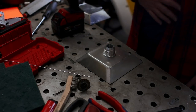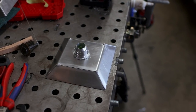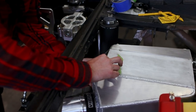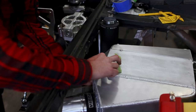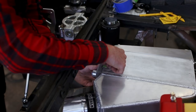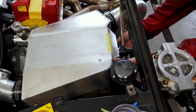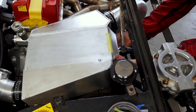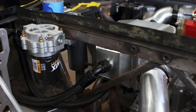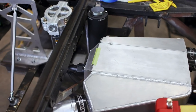This is a pretty good indicator of what we're aiming to make. It'll need a lot of finish welding, but it will do the trick and guide water flow through the intercooler core. The dimensions clear the rear bracing of the chassis and clear the blow-off valve in front of the intercooler, so everything fits. I'm just taping it into place for now to get an idea of how it'll look and confirm the hoses fit. Overall it looks pretty good — with a little modification to clear some welds once we affix it permanently, this is going to do the trick.